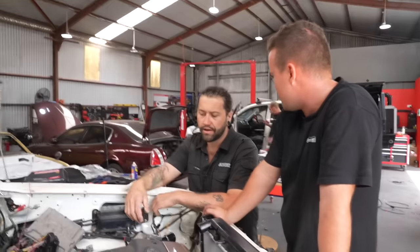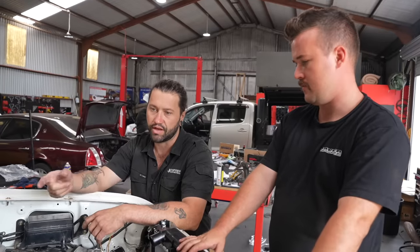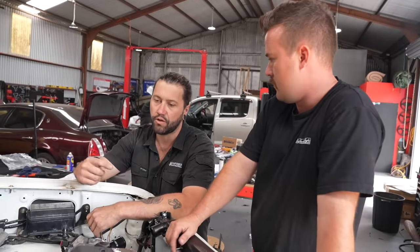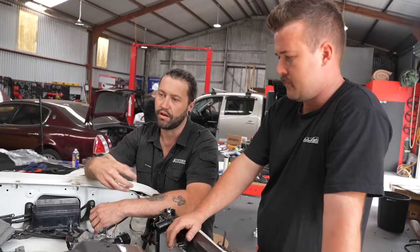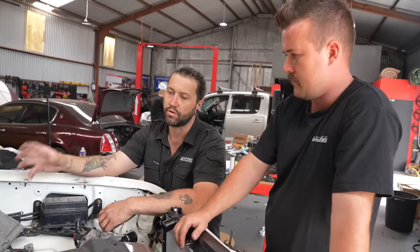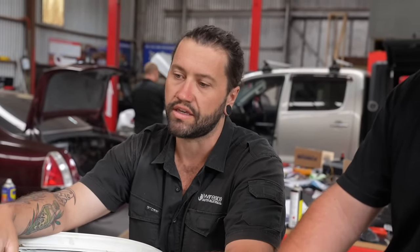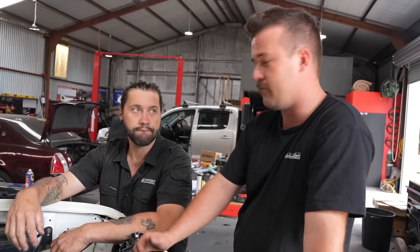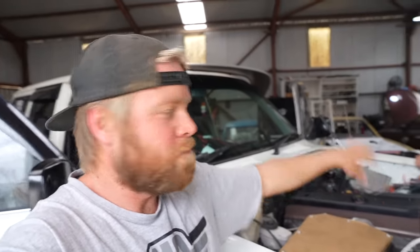There's still a lot of work to be done — so that's a big step. The biggest issue was that the coils have their own separate power supply which is not part of the ECU. It must get a power supply from the cabin in the Falcon or Territory from a different location to where everything else comes from. The ECU pulses ground, but the coils need a constant switchable power that turns on and off with the key so there's no draw. We've just tested heaps of work — valve springs aren't falling out, it started, timing's good. Heaps more work to do, but we finally have the car starting and running. Lots of wiring, whole fuel system to work out, and a billion small jobs.